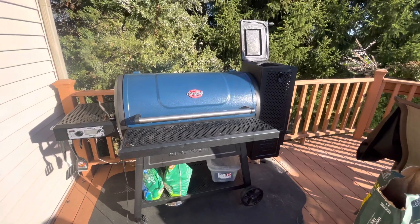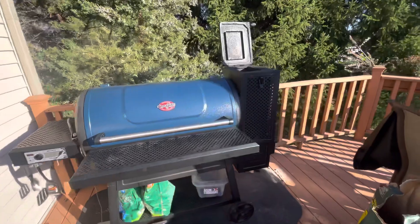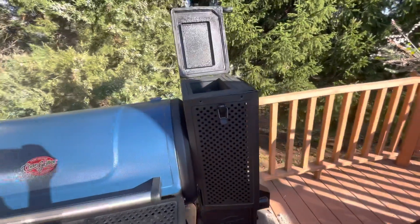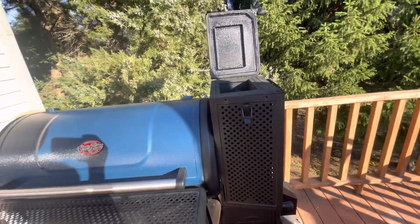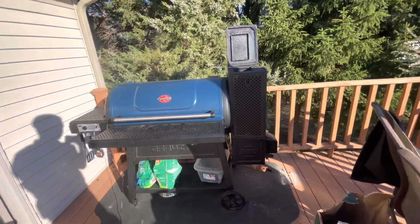Door open error with the doors closed — this plunger switch is probably your issue. A couple of screws, a couple of minutes, have a vodka soda while you're at it and you're good to go. Hit that like button and share with your friends so I get that ad revenue. Make it a great day.